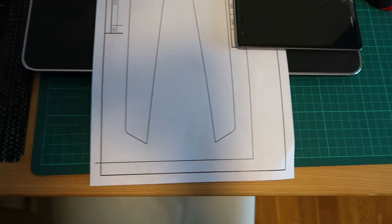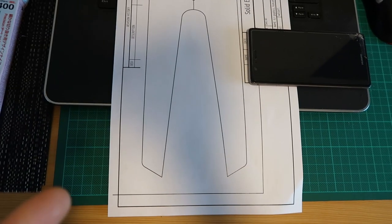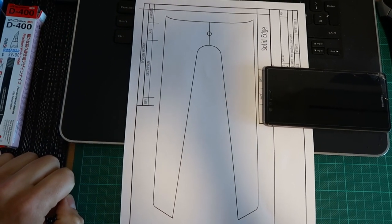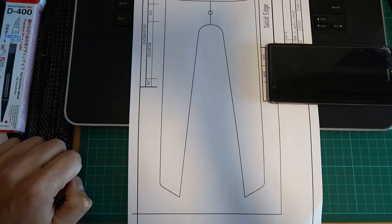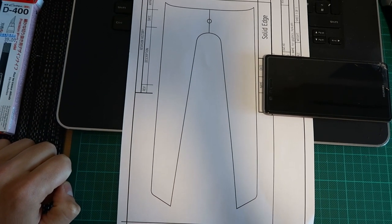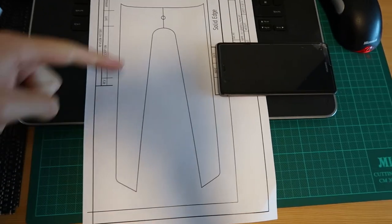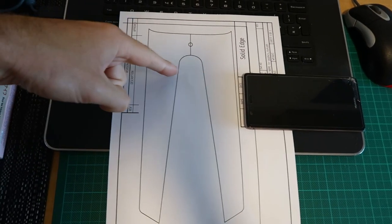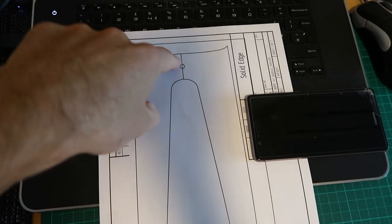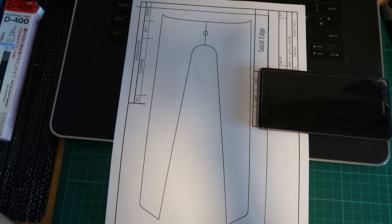This is the mask template I made for the fork legs, at a much closer scale to normal. I've now finished the bike, but this one wasn't really that successful because of the compound curve of the crown. It was really difficult to get the vinyl to stick and go around it without kinks, bubbles, or creases. Heating the vinyl stretches and expands it, giving you more material to wrap around small curves, which makes creasing worse and worse. So on the forks I gave up on the crown piece and cut the vinyl at the fork legs, using a separate piece of vinyl for the crown. The forks were a bloody nightmare and I almost gave up.